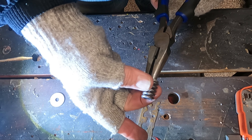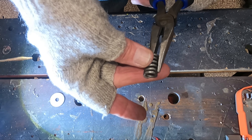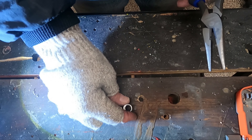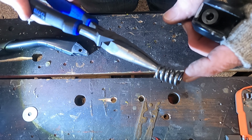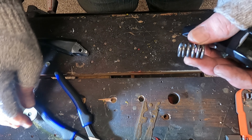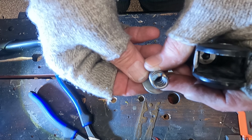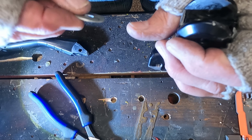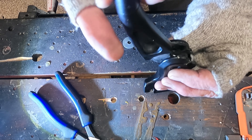I'm running out of ideas. I can tell this is a very cheaply, poorly designed kickstand. What I'm thinking is the surface that the spring sits inside — the receiver — the way these springs were wound and not ground down smooth. See the little reflective part right there? I can put that on the grinder so now that's smooth, same on both sides. I'm wondering if that might help the action of the kickstand going back and forth.